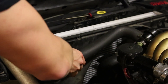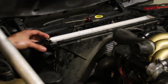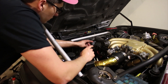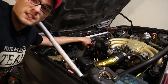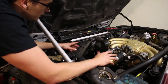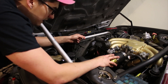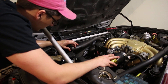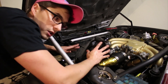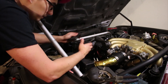There's a trick I like to do to make the whole bleeding process easier. I have all that coolant from earlier. I'll take off these hoses starting with the lowest one — this is on the thermostat right here. Take off the lowest one, fill that up, and that will basically fill up the radiator and whatever is missing from the block until water starts coming out from here, or here, or sometimes the overflow tank. Then I'll move to the second tallest one and do the same thing, then the top one. I did this in detail in a bleeding video — it's like how to bleed your M20. I have this actual support piece that goes on right here that we took off in the very beginning, and this just has to go back on.